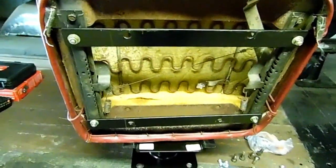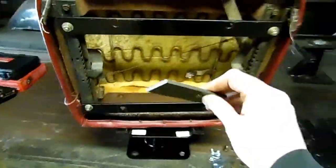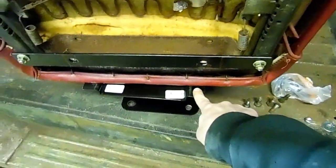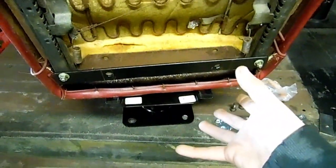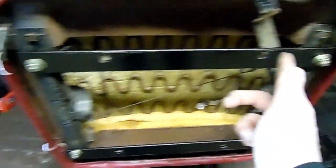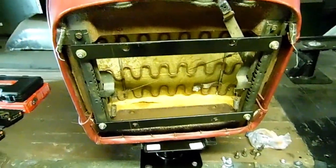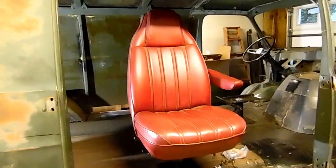These here are something that I made — it's just 3/16 stock, it's part of the same bar. I squared them up and tried to make it fit as close as possible to the holes on here. It's a little bit of improvisation because you had to drill some extra holes back here to compensate for the length, but side to side I just centered them up and bolted them in. These were able to fit on the elongated holes in the front, and then the back ones I had to drill some holes.